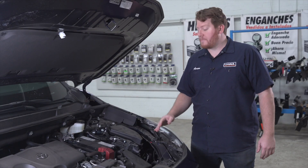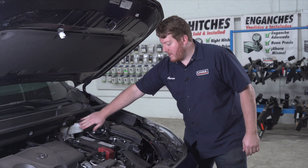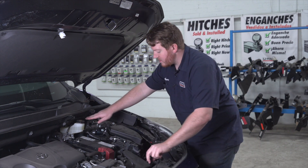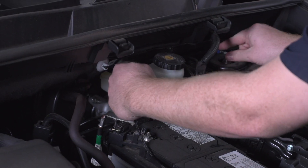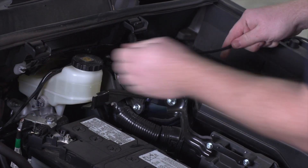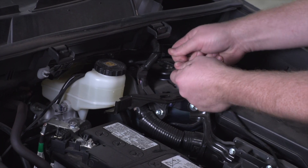If you follow your brake lines up through the engine compartment, it's going to come out right here next to the brake reservoir. We need to bring it over to our positive terminal, so we're going to route it around these wires right here, pulling it next to our battery. To keep it from falling back into the engine compartment, we're going to zip tie it nice and tight up to this loom right here.